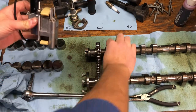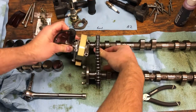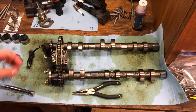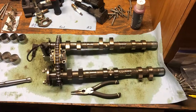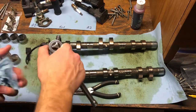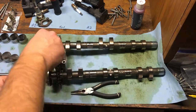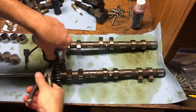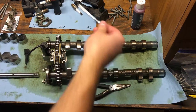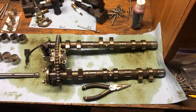Links are lined up. There they are — now time to wrestle with this thing. Sorry, I had to pause the video. You just kind of have to finagle with it. Now it's time to take the tension off of the solenoid and let the spring release — because remember, reverse threaded. Got the special tool out. Cams are still in time, so that's awesome. That is now done.